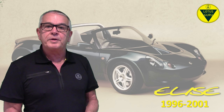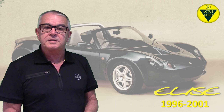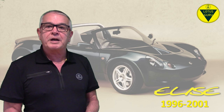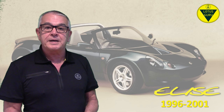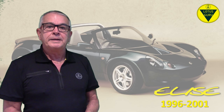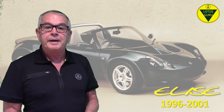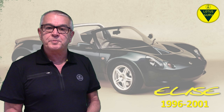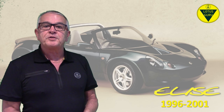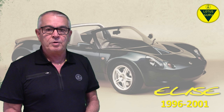The problem encountered with these is condensation building up on the inside of the cover. There isn't a fix for this really, and Lotus got a lot of complaints about this at the time. All the factory recommended was to turn your headlamps on and it will eventually clear, which it will, but sometimes it can take a long time. It's not much of a problem in hotter climates, but here in dear old damp and cold UK, it was. Another drawback of the covers was dirt and dust getting into the space underneath. The factory-fitted covers had a seal fitted around the headlamp which stopped some of it, but not all of it.